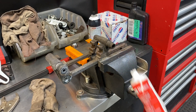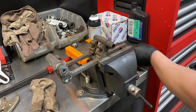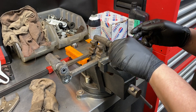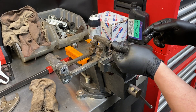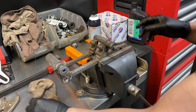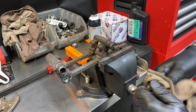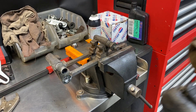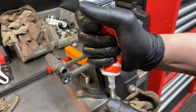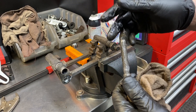Then take the pin to the bench grinder wire brush and clean it up nice. Once the guide pin is cleaned up, apply silicone brake grease to it — this protects and lubricates it. Once fully lubricated it'll slide right in and out. Don't forget the other side pin that wasn't seized — clean it off quickly and put a healthy dose of grease on it and smear it around, just like new.